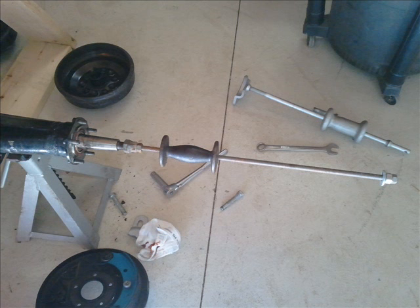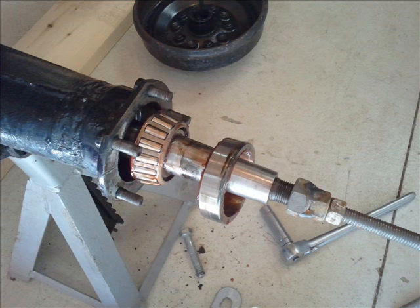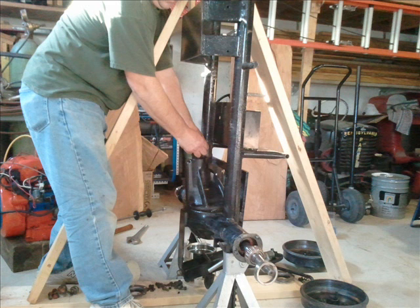I made up a slide hammer to get the axles out — they just pull right out. There's a nut welded to another half inch by 13 nut with an all-thread rod that I used to pull this one out. A couple of smacks will pull the bearing out with the race. The race is really all that holds it in there, and then the back plate for the brake captures it.